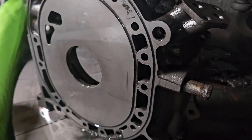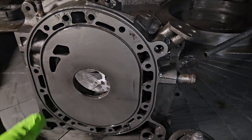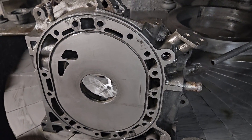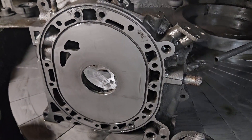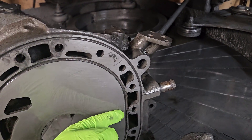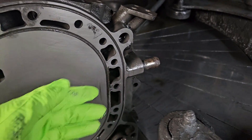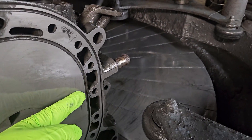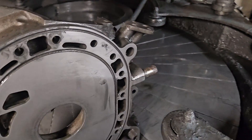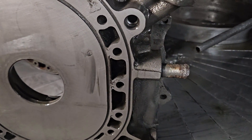This housing is already well into lapping. I've cut off about two thousandths, and we're going to get close to three thousandths of material removal. And if you look at your OEM specifications — what the OEM Mazda Workshop Manuals say — you can't have any deformation around your water seal area, whether it be the rotor housings or your side plates. As you get into warpage or variation, you lose your metal-to-metal contact seal, which is your primary seal. If you don't have good metal-to-metal, those water seals can't really do their job.